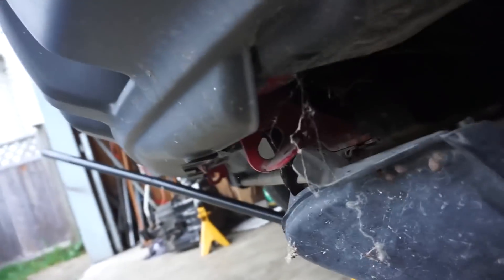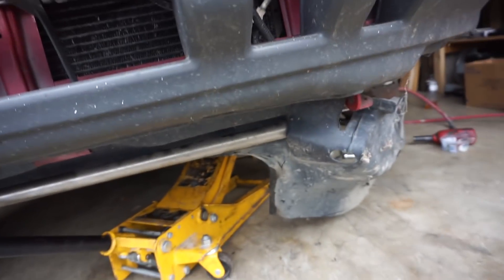Next we're going to be draining the coolant because we're doing the water pump. The water pump is driven off the timing belt. Looking through this cover, there's a drain hole and a little valve. Grab some needle nose pliers, crack that loose, wind it out by hand, let it drip out, and collect it. Remember to tighten it back up when you're finished.